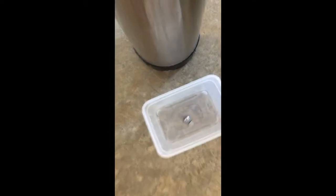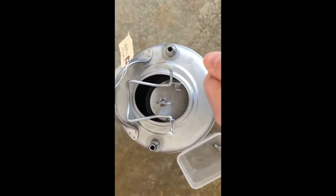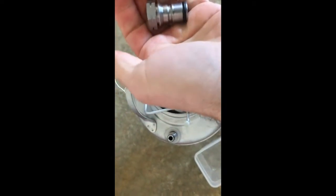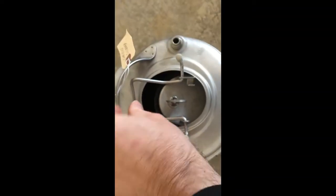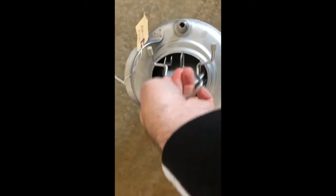I like to use this little Tupperware container so you don't lose track of anything. This is where the CO2 goes in — just want to break that apart here. You can see there's another little O-ring in here. Also, the post has a notch on it that lets you know that it's CO2. We'll pull out our top here, just turn it sideways, and we'll take off this O-ring.